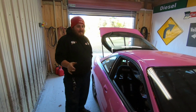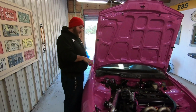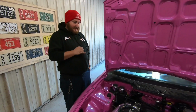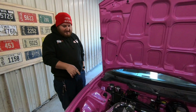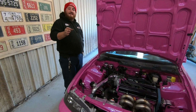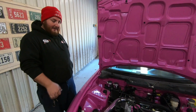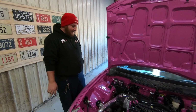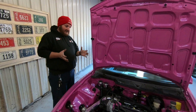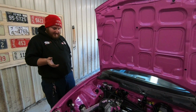And then the other dilemma was we were trying to figure out why the starter was not kicking over. Now, here is a number one thing to remember. Everything on a car needs to have a ground. As you can see, obviously everything in here has been painted. The previous owner decided to paint the entire starter. There was no metal-to-metal connections absolutely anywhere. The starter was getting absolutely no ground, and we literally took everything off, sanded down the transmission case where everything bolts to, and got enough ground to where the motor would actually kick over.